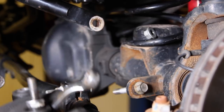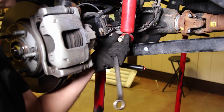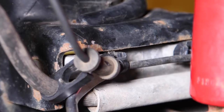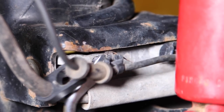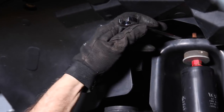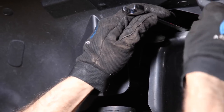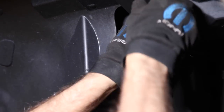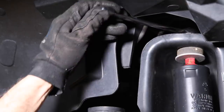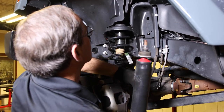Keep tooled up with that same 18 millimeter combination and remove the lower shock bolt. Pop the harness and brake lines loose, then move to the top of the shock. Remove the upper nut with a 5/8 end wrench — a flat ratchet really helps speed it up. I used a 16 millimeter on the painted shaft nut because the 5/8 was a little tight. Do the same procedure on the passenger side shock.